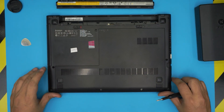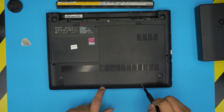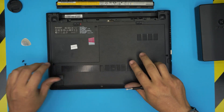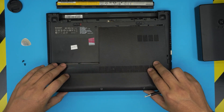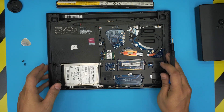With these two tools on hand, we're going to proceed. Remove the two screws on the front end of the laptop in the middle. Then slide the cover towards the front end of the laptop — about half a centimeter as far as it can go — and then just lift it up.